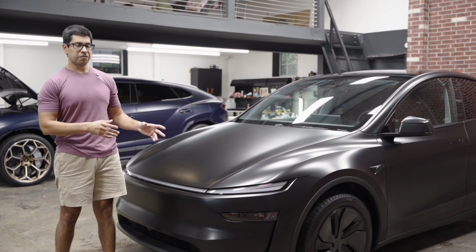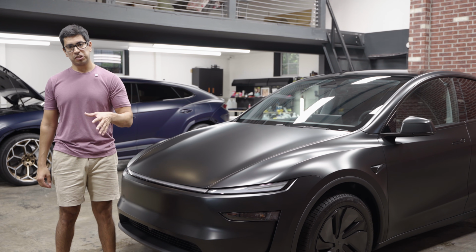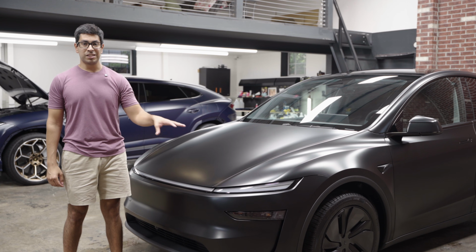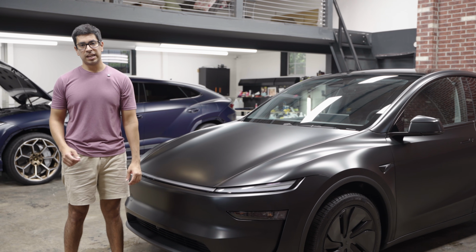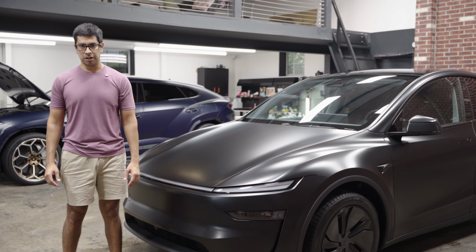So during the finish work phase, we will also do heat sealing. When you lay the paint protection film, it's a wet install. All of that moisture stays trapped in the film, especially on the edges. Once we finish the install, it will slowly evaporate and lift these edges. So we're going to come back with our heat guns, set everything down, lock it in, make sure that glue is holding tight for the long term, and then it's good to go.